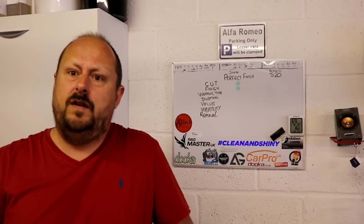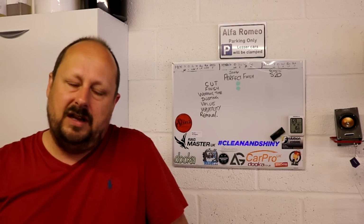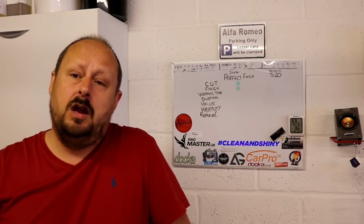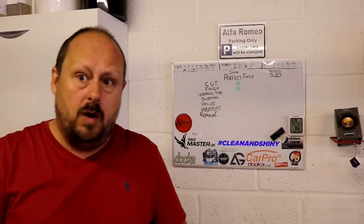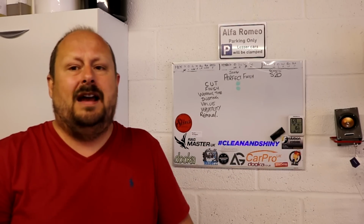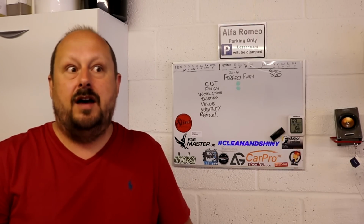And that is your final finish delivered, as well as being able to cut out all of the sanding marks and all that sort of stuff. So that's how it's been developed, and Jesus, it does that well. I tell you, you can really unlock the cut when you work this on a rotary with a bit of pressure. And it can take it. You can overwork it as well, and we're going to talk about dusting and all that sort of stuff a little bit later on. But the working time of this is more than adequate for how quickly it delivers you the cut and the finish.